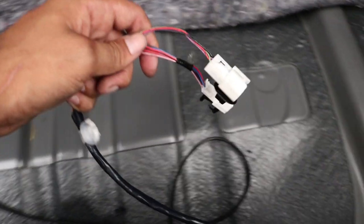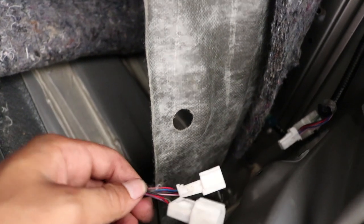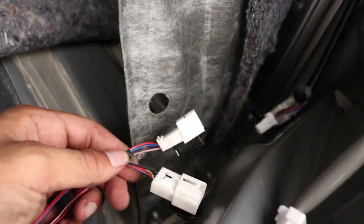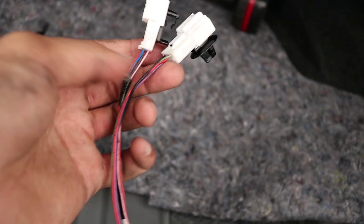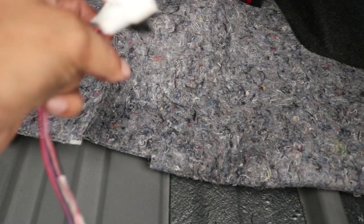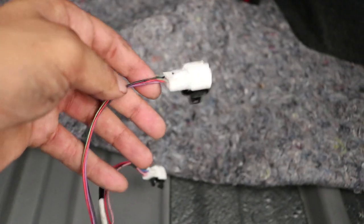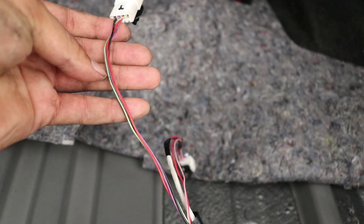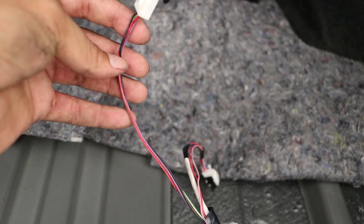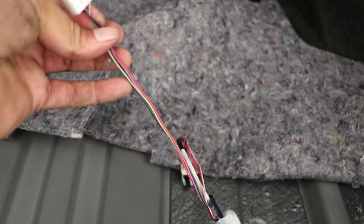Then the main body harness for the tail lights — you're going to come over here. You have to pull this back and unplug these two connectors from behind the passenger side tail light. You're going to want to be working with the bigger of the two connectors. Strip back the electrical tape, separate them, and strip the electrical tape off the bigger connector. Then clean up the wires so that residue doesn't interfere with your soldering.